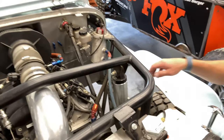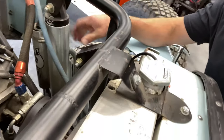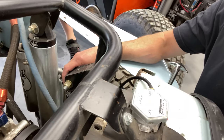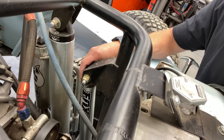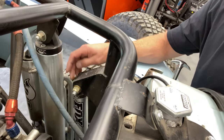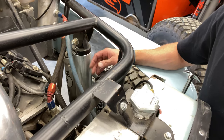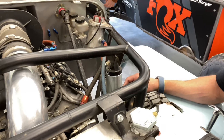I've got Fox 2.5 bypasses and then a very strange setup — I got some air shocks on leaf springs. Everyone's like, what? But it's perfect because it gives me a little bit of ride height on the trail, a little more control like you get from a regular shock, and then the bypass comes in when you're hitting stuff faster. It's kind of like pre-DSC — playing with stuff before Fox had the DSC valves.